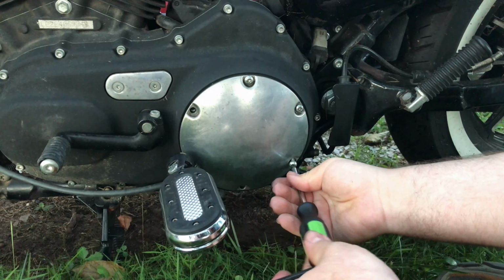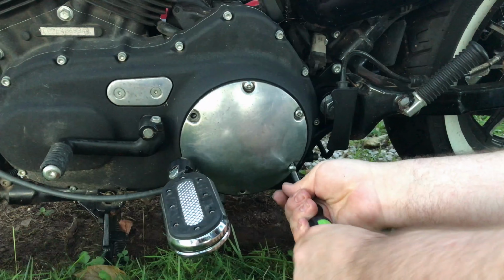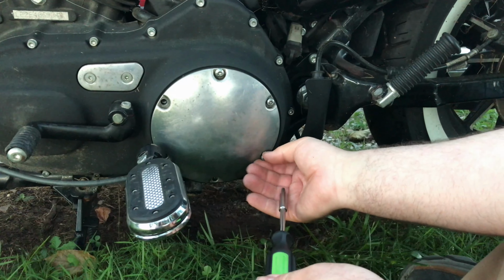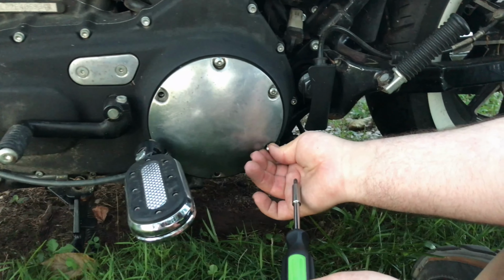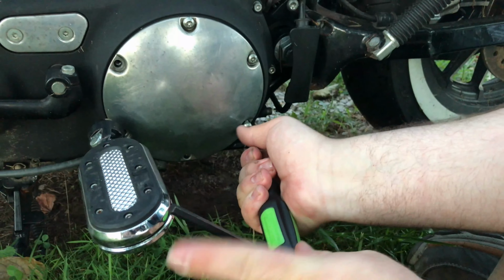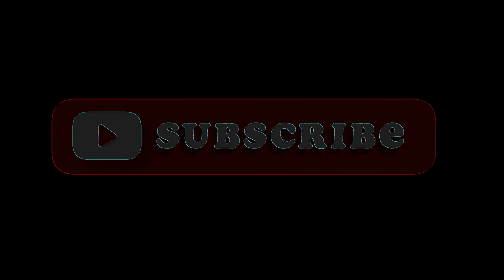That's all of it. Once he finishes putting these primary screws on, he's done. And again, see what kind of clutches you got. Now, Patrick has got stock clutches in his. But if you've got these aftermarket clutches, these high-dollar clutches, they may recommend a different type of gear oil, like Red Line or something like that. But if it's just stock, you can use the 75W140 fully synthetic gear lube.